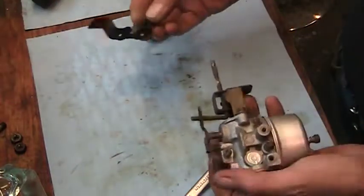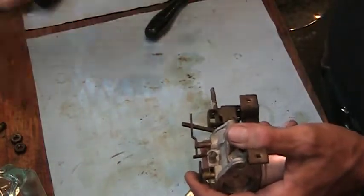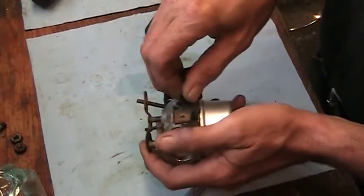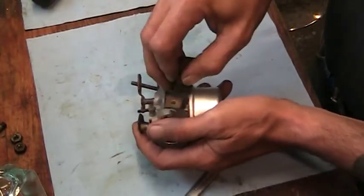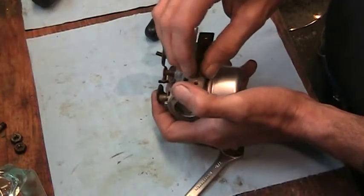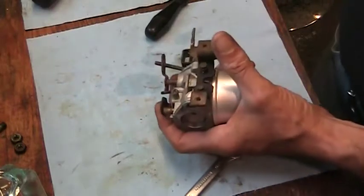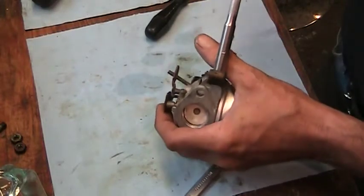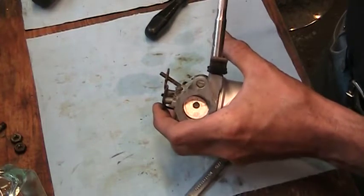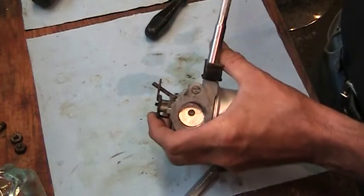We'll get this side bracket bolted back on. We'll get it back assembled on the air manifold, and get it bolted back on the engine. Before we test run it, I gotta change those fuel lines. They're rotten, leaking. I don't want any problems later. Do it now while it's already half apart.